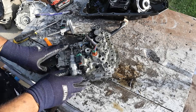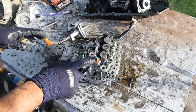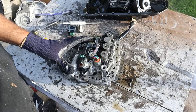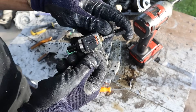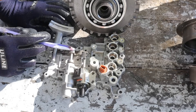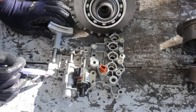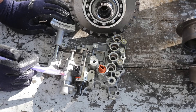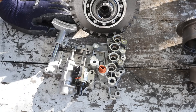If the pump is the heart, the valve body is the brains of the transmission. This is basically a giant control with four solenoids and a pressure control switch. Pressure comes in from the oil pump, and the solenoids redirect it to either lock up or unlock clutches and variators to control the transmission properly. The servo motor adjusts the amount of fluid pressure going to the variator — it moves in and out and is connected to a T-joint that rides against the variator itself to sense its position. In between there's a hydraulic valve with three main modes: apply, release, or hold fluid pressure — essentially a closed loop control circuit.